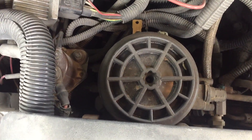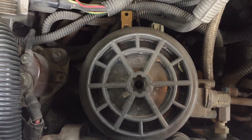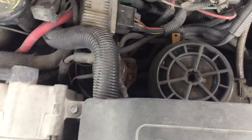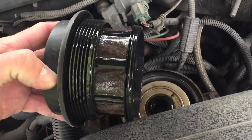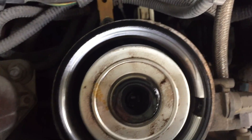Now if you're reusing the top of the fuel filter housing, make sure that you don't use a claw type oil filter wrench. But because I'm replacing it, I don't have to worry about damaging the top of the filter housing, so I use an oil filter wrench to take it off. Here's the old fuel filter, and as you can see there's already debris and all kinds of stuff sitting on top of the filter that it's keeping out.